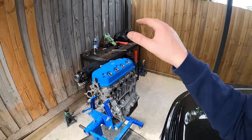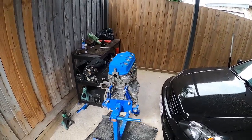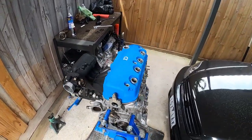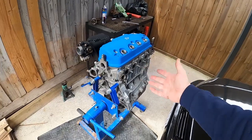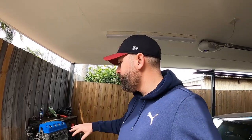That's why most of this video is going to be on a time lapse. You'll get to see what I did wrong and all the times I stop and scratch my head and worry and get nervous, but it'll all be there. But the Big D series is ready to fly now. So hopefully we can turn this up from 14 psi to 20, 25, maybe even 30, and start making some serious power. I'm thinking about, because it's a track car, I might leave it on around 18 psi and then have a switch with an electronic boost controller.